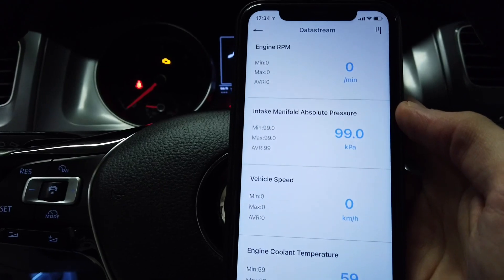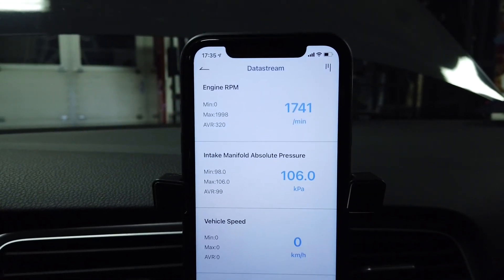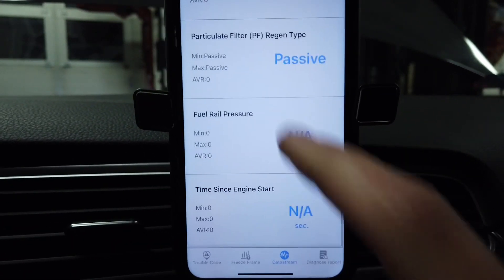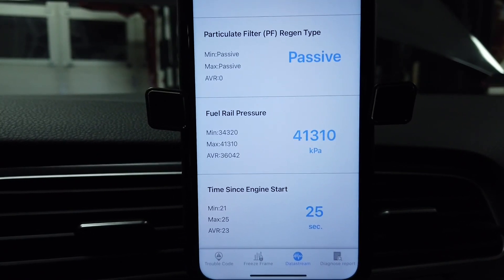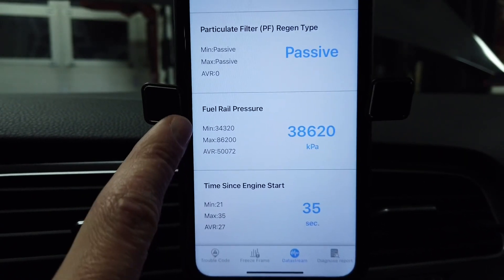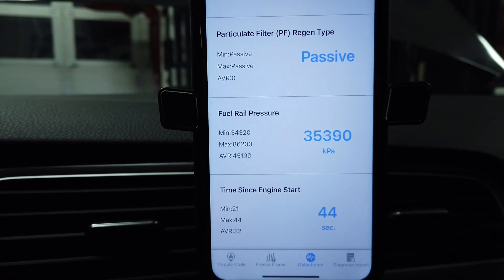Let's start the car — it'll be easier to show with the phone so you can see RPM live. If I rev the car you can see it increases. Let's go to the fuel rail pressure data. We can see it, and when I rev the car you can see how it moves up. You also have minimum and maximum values as well as the average value calculated over the period your diagnostic tool has been active.